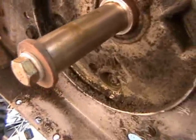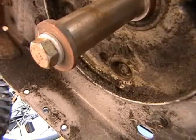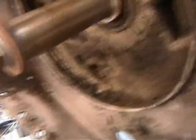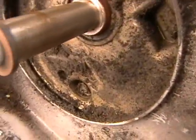Now I'm going to get the very special thing everyone loves in these things — the vari-drive. I'm going to take it out. Before I do that, I took that engine pulley and put the bolt back in so I wouldn't lose it. That's a tip everyone should use because I've done that several times — just mount it back up there on the shaft. All right, let me go get some tools.